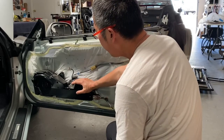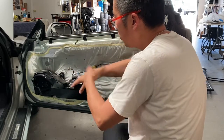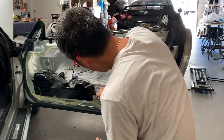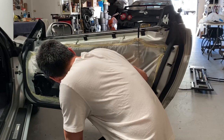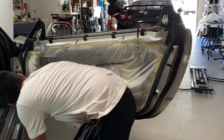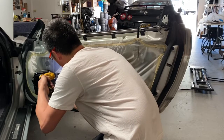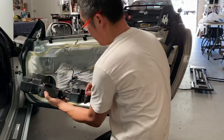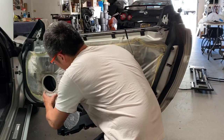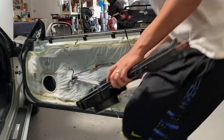The door is in pretty good shape with the plastic still in place. We're going to remove the Bose speaker unit and build our own six-and-a-half inch speaker baffles, then install brand new Hertz speakers, dynamat the doors, and run new speaker wiring through to the new double-din radio. We're not reusing this Bose speaker system. Take out the remaining screws — hold the unit so it doesn't fall — and the whole panel separates. There will be one Bose unit on each door; we're setting them all aside.